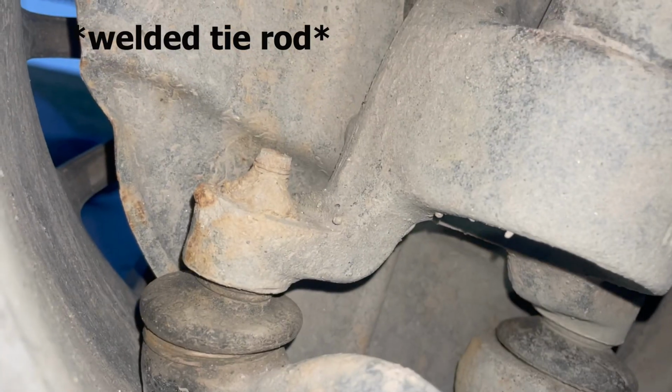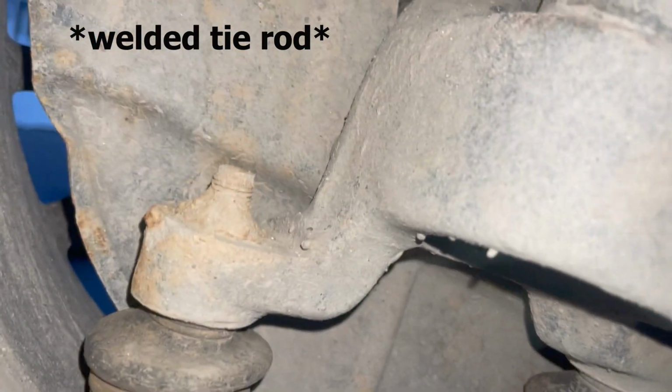So I went ahead and took a gander underneath the car to see what was causing the steering to shimmy so much and the alignment to be so far off. And so I saw this underneath the car. You know, you find something new every day. It's pretty bad. That's all weld. So that is going to have to get cut off and ground down to where it'll be flat to where the knuckle can actually hold a new tie rod. So that'll be in the next video sometime soon when I can buy the parts for that, and the parts will get here so I can put those on and get a new alignment. It'd be so much better.